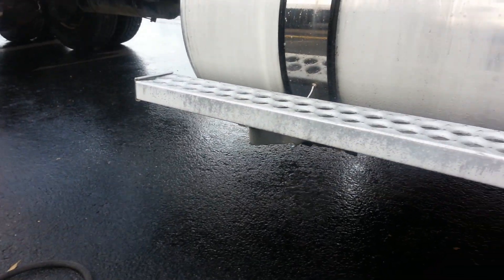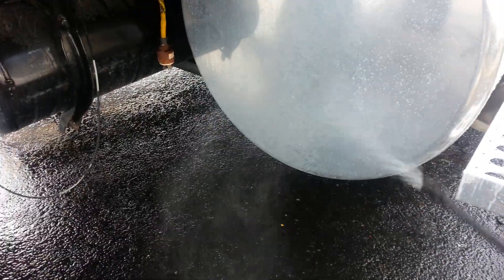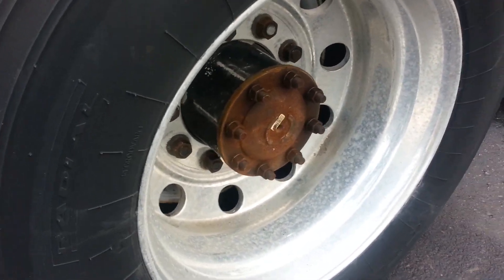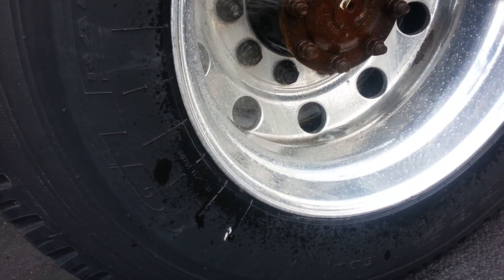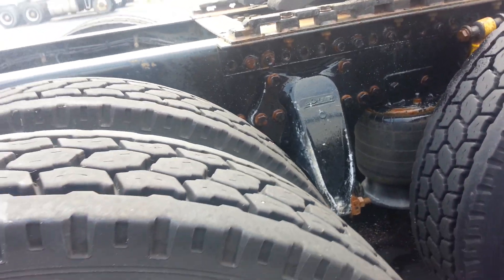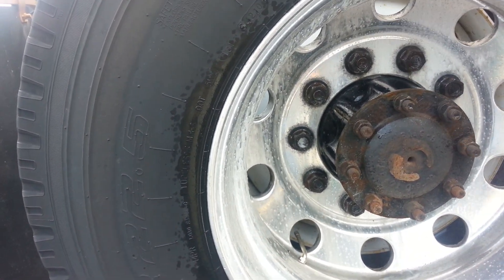You can see what it's doing — it's turning all foamy white, reacting with the aluminum. That's natural, you want that to happen. Try to do it on a cloudy day. Get the back of the tank, just spray it up on there. Let it sit for a good 30 seconds to a minute. Spray up under there, get around your legs — it's not going to hurt the rubber, it's not going to hurt any metals you put it on. It's actually going to do it good. Get rid of that salt. If you're doing this on your big truck, I like spraying the framework with it — that's going to get rid of the salt around the nuts, and that will help keep the paint job on there for a lot longer.